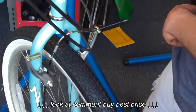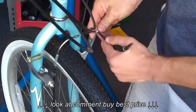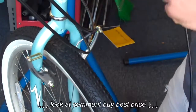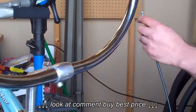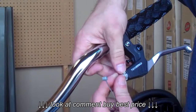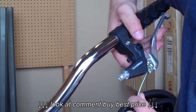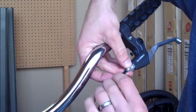It's very simple. With both brakes and also with gears, you always want to loosen the cable first — that's the first step. Go over to the handbrake and line up the slots again in the tension nut and the lock nut. You'll find a tab on the handbrake and you can slip the cable into that, then just spin these away so that the slots don't line up.